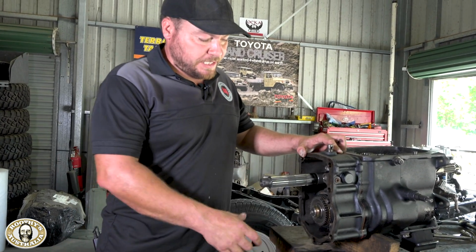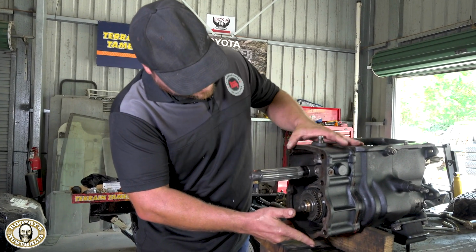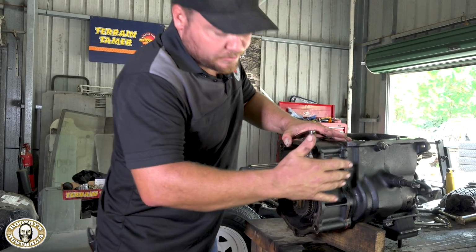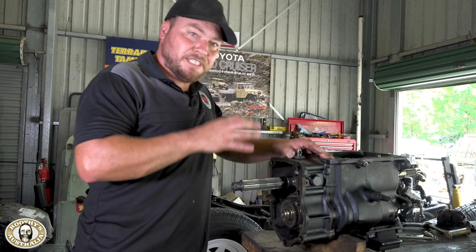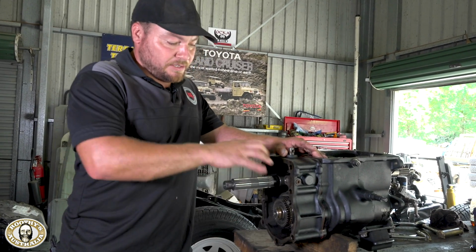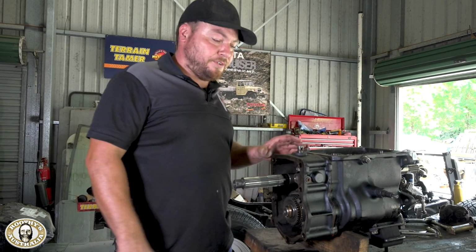So we just put the fifth gear housing on. You'll need to lift up the fifth gear selector to get over the selector fork itself. That goes on the dowels. Now, you don't put any bolts in at this stage, you wait until the front part of the transfer casing goes on. So another gasket, and then the front transfer case, and bolt right through.